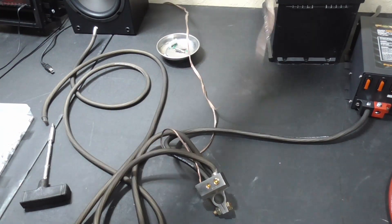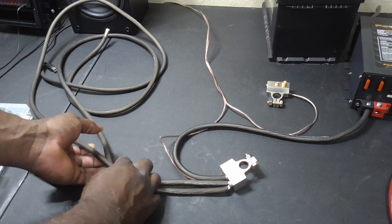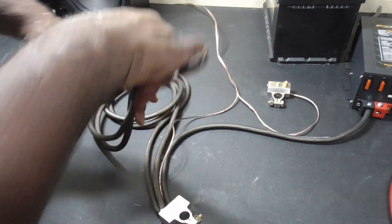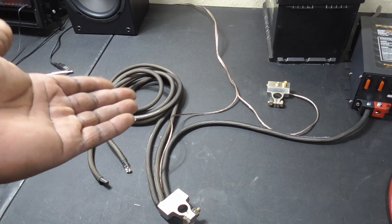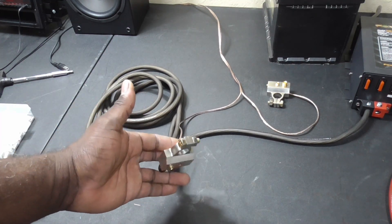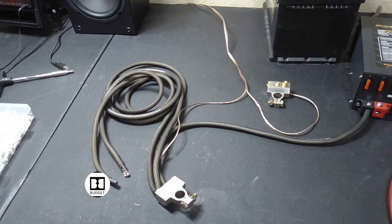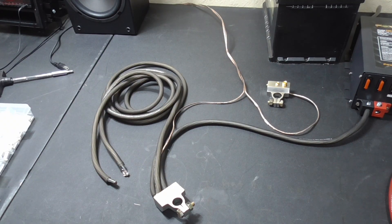Let me get the spaghetti out of the way so you can actually see what it is that we're accomplishing here. What we're accomplishing is dual runs. Let me make it look pretty. There you go — those are your dual runs. You can do this with any size wire. In our case we're using four gauge. As long as you have an adequate piece of metal here — I believe this is brass, way heavier than aluminum — you can do this. This is what it looks like. We're going to do the exact same thing with that other one, then go ahead and get the amplifiers set up.